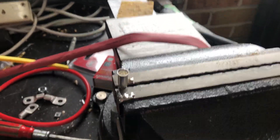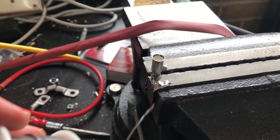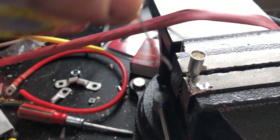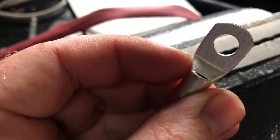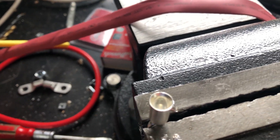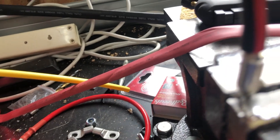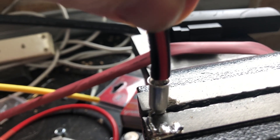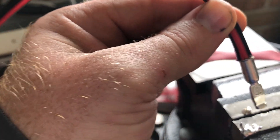Making up the connector for the solar now. With these, get a butane torch and solder — basically just heat this and melt some solder into it, then drop your wire in. It helps to get a better connection, then you can crimp it afterwards and put heat shrink on. It helps hold it in because they're circular connectors and don't have a tab at the back like the other ones. Soldering is a really good idea. Always remember to check how much wire will be exposed afterwards — you might want to cut it back a little so none is exposed. As you can see, I just pulled that out and had enough to pull it out of the vise without pulling it out of the socket, which shows that soldering does give you a better connection overall.